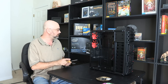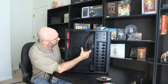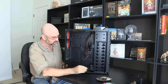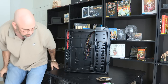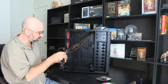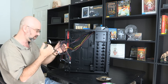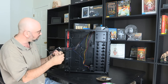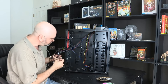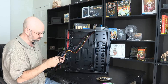We're going to look at the cables here — I've got a lot of stuff in here, a whole bundle of joy. We've got the power switch in here, and we've got a SATA data cable right there, and power which will go up to the SATA power connector up there.